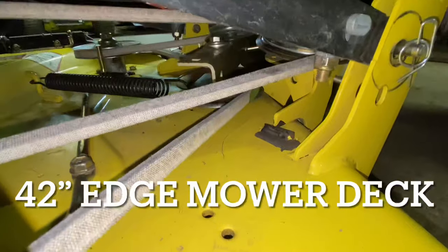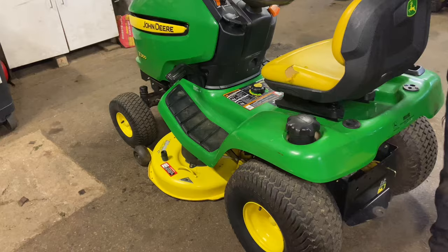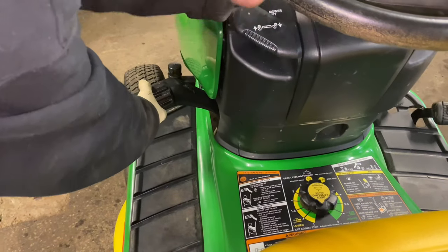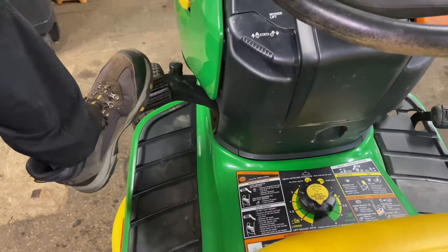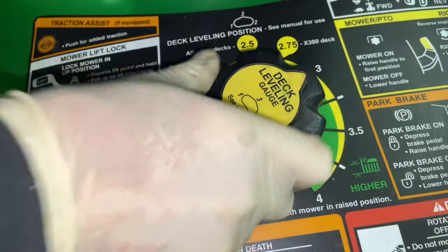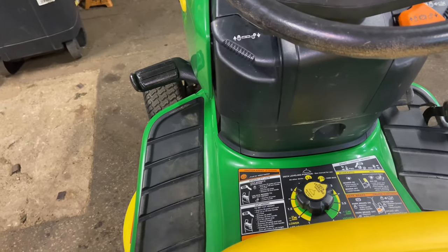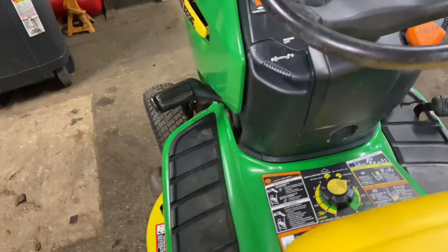That's pretty much how you put the belt on for a John Deere. Once you have the mower deck on, come over to your deck height pedal. Since we have it locked in the back position, pull that back a little bit and push your lever down — that allows your height adjuster pedal to work. Push your deck all the way up, go over to your height adjuster, and set it back to where you had it — let's say three — put it back down on the adjustment notch. That's the height adjusting lever you use with your foot.